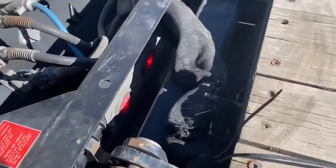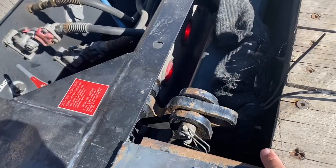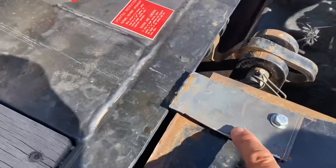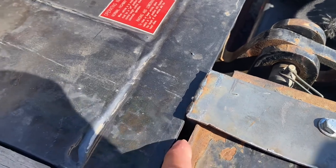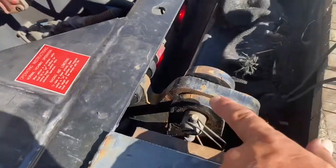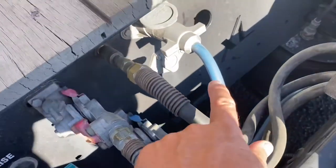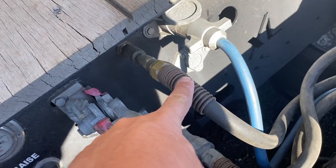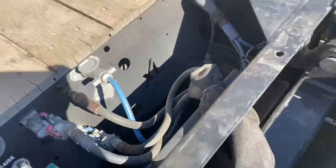We're done here. As I said, the small bolts are not to hold the weight — just to keep the third axle from going backwards, such as when going up a hill. All the pressure is at the main point. We fabricated this small piece ourselves — it's about a quarter inch — because we lost the original pins. The deeper and wider you make the distance at the pressure point, the more weight you put on the third axle. We have three hoses and an electric line: the regular brake line, the red and blue air lines, and one line to level all the airbags between the trailer and the third axle so they're all at the same level. Then the electric line. Thanks for watching, don't forget to subscribe!